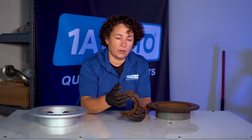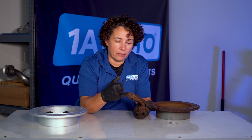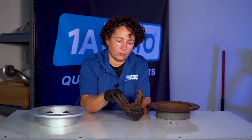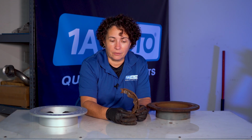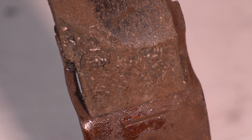If that is frozen, if you don't assemble that correctly, put like a little caliper grease in there, and sometimes they have a spring, what they call a spring washer, and it keeps a distance in there so that that doesn't seize up or get rusted. If that's frozen and you apply that, it won't retreat. It won't go back like this. It'll stay out even though the cable retracts, if the cable's good. Now, it's going to ride inside there and cause all this breakdown also because it overheats, heats up, and breaks, becomes brittle. And the bonding, the glue will heat up and come unglued.